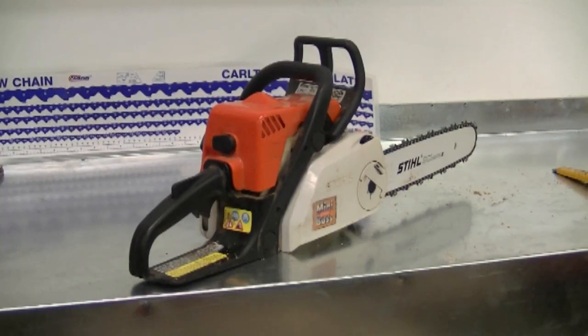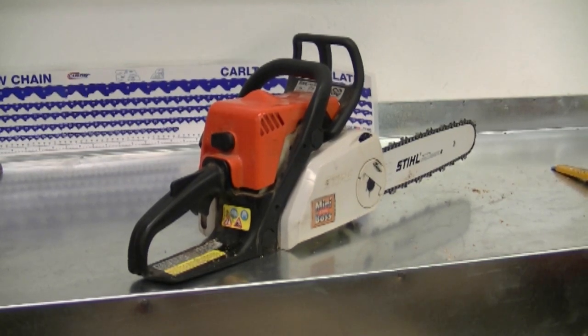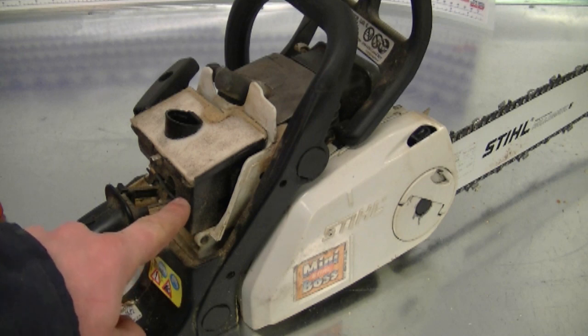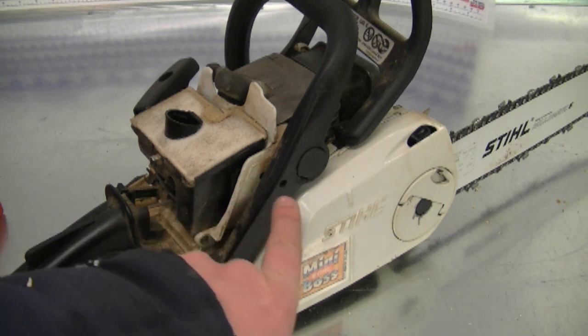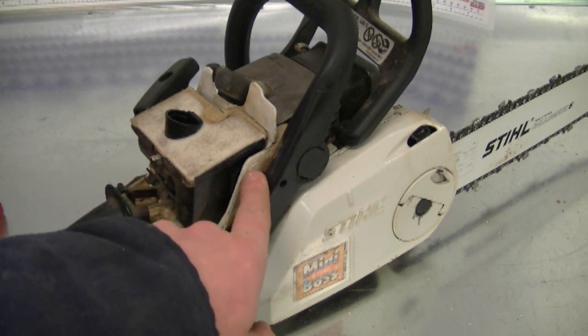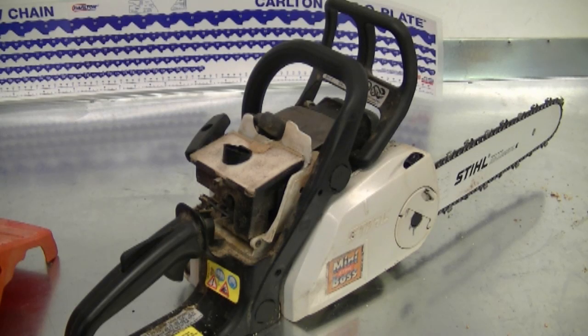The first question today is something YouTubers often ask: is the carburetor on the Stihl MS-170 and MS-180 chainsaw adjustable? The answer is no — the carburetor is non-adjustable. You'll find the same carburetor on both models. If you take the cover off, there are no adjusting screws at all. The only screw is for idle speed, which you adjust through a hole with a screwdriver — turn in to idle faster, turn out to idle slower. I have a video showing how to adjust the idle speed and I'll put the link below.